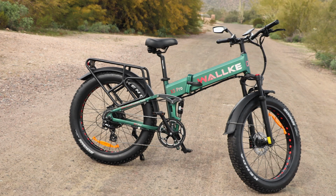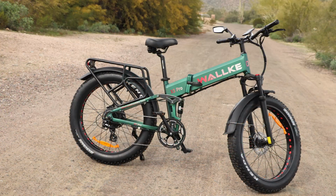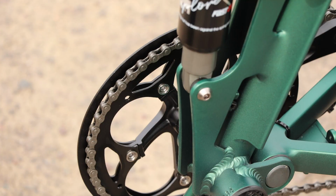The upgrades, higher performance and longer range, do add up to a weight penalty. This bike is about 8 pounds heavier than the last, and you can feel it if you're riding uphill without motor assist. However, on level ground it's hard to tell the difference, which seems about right. The variance would be about the same as riding the bike with my accessory bag or without. You can certainly feel the power difference, with noticeably improved acceleration and hill climbing performance. The larger chain ring greatly improves your ability to assist the motor at high speeds.